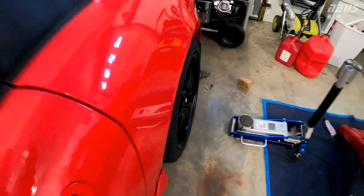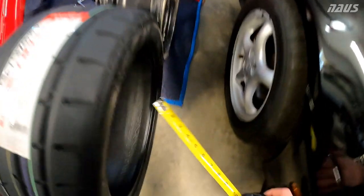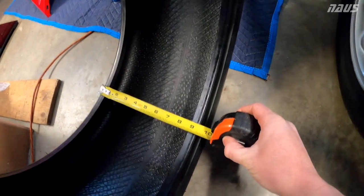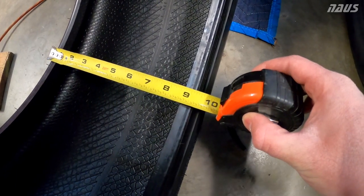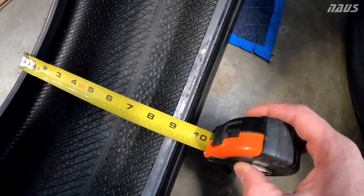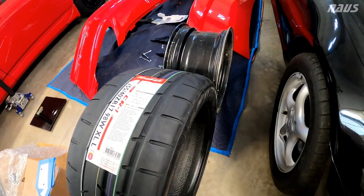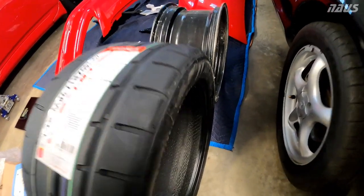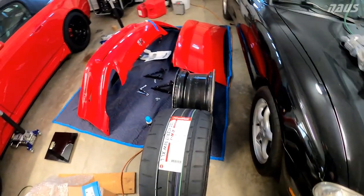They're a pretty good fit for a 9-inch wheel, but when you look at these CR1s and take a measurement inside lip to inside lip, you'll see it's about 9 and 3/8 inches bead to bead. So the natural profile of these is already bulging quite a bit just sitting here, and mounting them will pull in another 3/8 of an inch onto my 9-inch wheel.